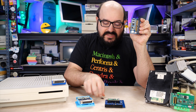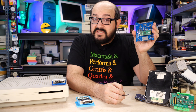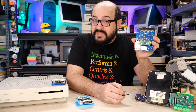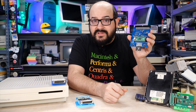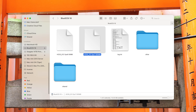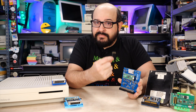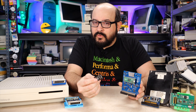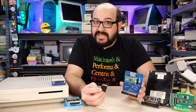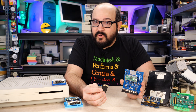This makes it easy to swap operating systems or transfer files to and from different machines — all you do is swap that little microSD card. Some models, like the BlueSCSI version 2 internal edition, use a full-size SD card slot, so you could use an SD to microSD adapter to use the same card across all devices. The BlueSCSI makes it super simple to store data because it uses disk images. All you have to do is place an appropriate file on your microSD card and plug it in. You don't have to worry about the actual format of the SD card — a FAT32 or exFAT SD card works just fine, and the BlueSCSI does all the work to make sure your vintage machine works perfectly.